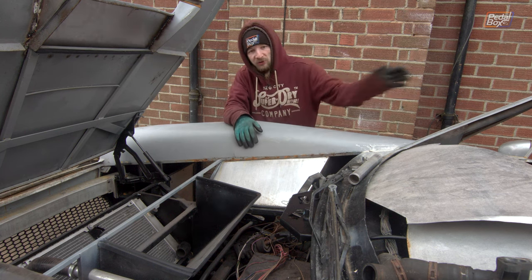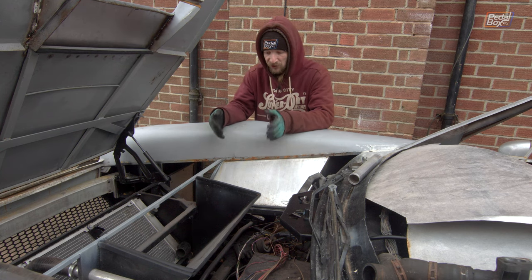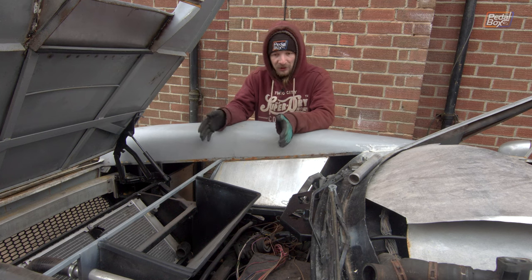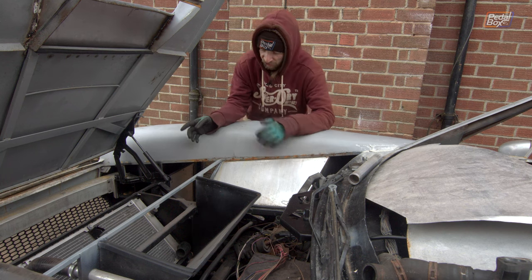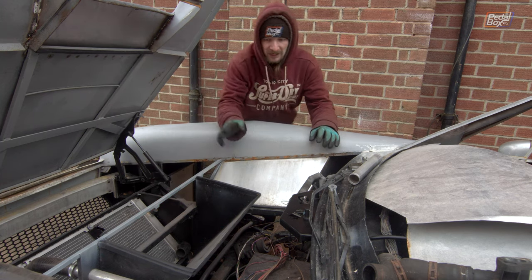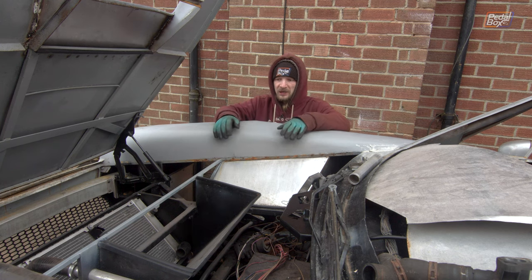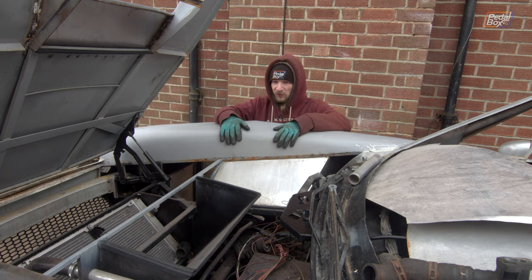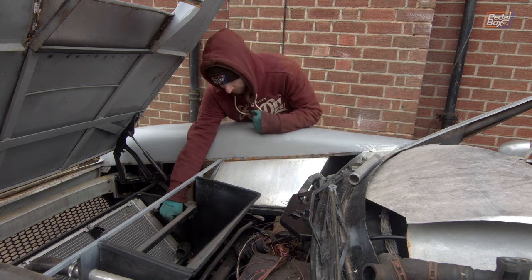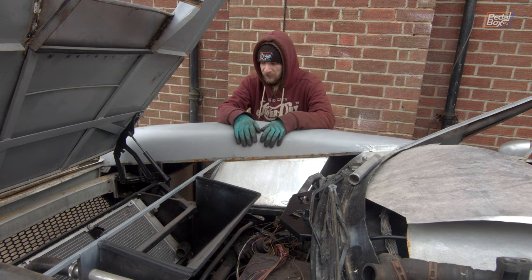Because this scoop is meant to take in outside air — full of rain water and splashes — we'd want the hole around the pipe to be sealed. We've basically concluded we're not going to be able to match the hole accurately enough to seal it at all. So we're going back to an old abandoned plan: send it out through the side into the wheel well and loop it back in. The holes will be circular, which we can tolerance nicely, and it's out of the air stream so we don't have to seal it as critically — a double win. We've figured out the contraption of silicon hoses and rubber bits to get from the radiator outlet through the sidewall and back to the existing hose.